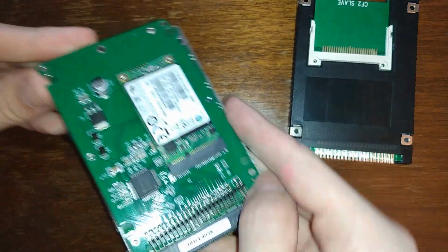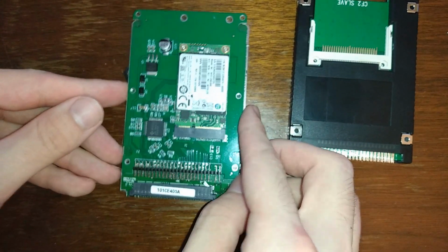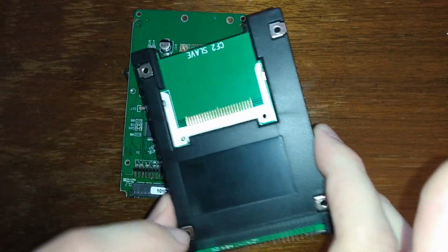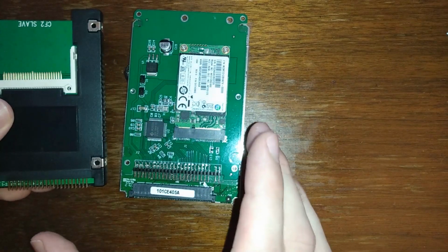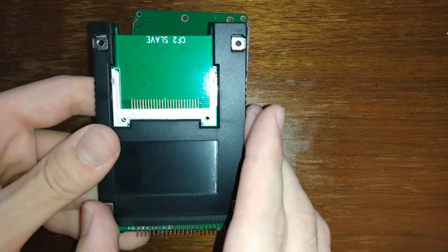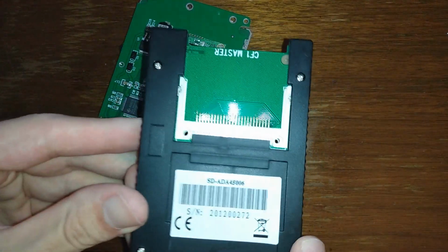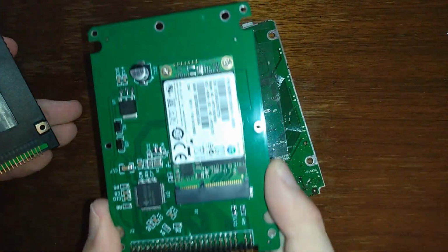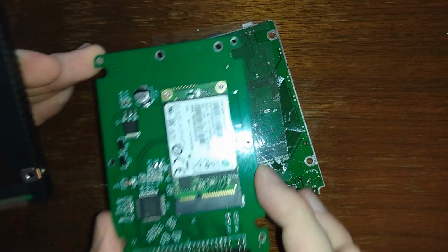The entire drive ends up sticking out at a 30-degree angle, making it impossible to compress the individual components together without brute-forcing them and likely damaging the socket. It is possible to put one of these adapters in the player at an angle and cheat by using the backplate to compress it in place, but the entire assembly will be partially loose and it's not ideal.